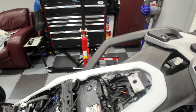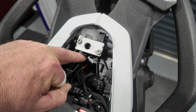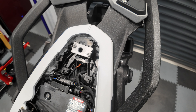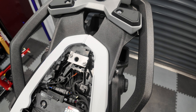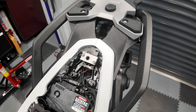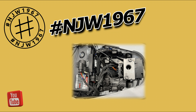At the back I've tidied all the wiring up and made some measurements of the plate area. There are some tangs in the seat that clip the alarm in. I'm going to cut a piece of black PVC acrylic to size so it fits in that area, giving me a nice firm base for the dash cam to be adhered to with 3M tape, and it'll also allow it to be easily removed should I need to access cables underneath. The first issue I came across on the new 1300 GS was where to mount the video control unit. As the bike didn't come fitted with an alarm, I saw the opportunity to use the aperture where the alarm would be fitted.